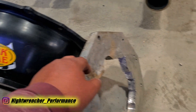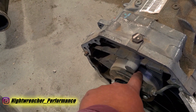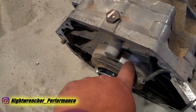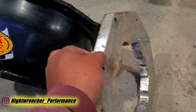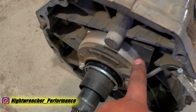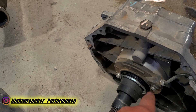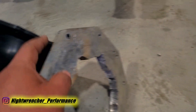The second spacer you're going to have to make is the one that sits below the slave cylinder, and that's going to be about a quarter inch taller than the plate — so if the big plate is three-quarters of an inch, the other spacer should be about an inch tall. I ended up using a one-inch plate and then made myself a one-inch spacer behind the slave cylinder, with a quarter-inch plate underneath to bring it out another quarter inch. So I've got one and a quarter inches behind the slave cylinder and one inch on the plate itself.